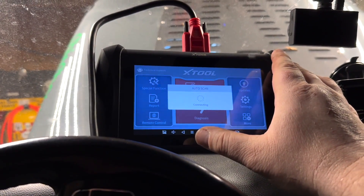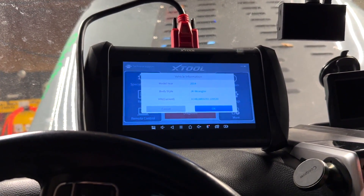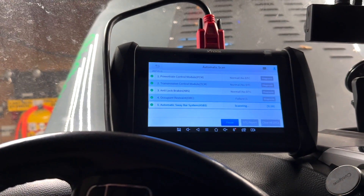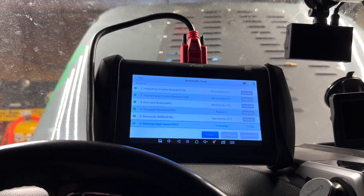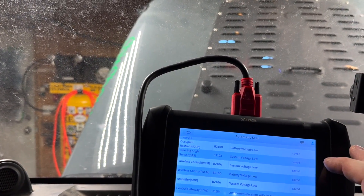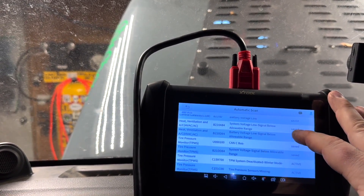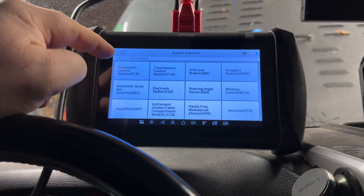Updates are all done. Let's do the auto scan — that's a big thing for me, because if you can't acquire the VIN, which it did pretty quickly, you automatically won't be able to get all the features that a bi-directional scanner has. We're just scanning right now — it's fast, holy crap, I can't believe how fast it is. Looking at the results: low voltage across several modules, but nothing really all that worried about. Pretty impressed with how fast it is.